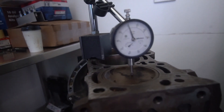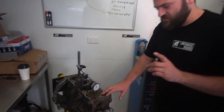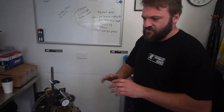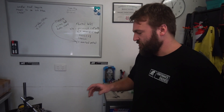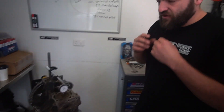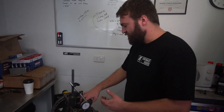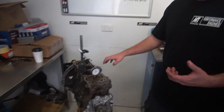So explain why you've got this little dial indicator set up in this dummy block. From factory, any manufacturer of crankshafts mass-produces crankshafts very quickly — whether it be Honda doing selective fit pistons in bores, Toyota do the same, Nissan too. Everything's done very quickly, so there's going to be variation in tolerance, and you'll find things like bearings have color codes or sizing codes.